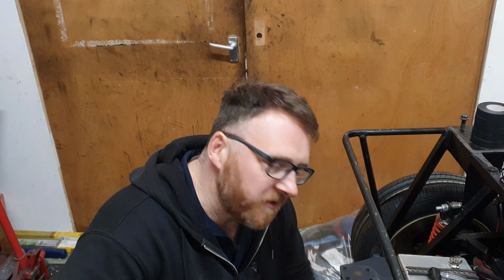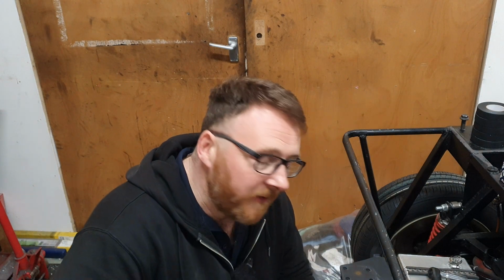If I'm going to get fuel surge issues, and yes, I know guys have pointed out that putting some form of baffle in the tank would help. I don't want to butcher this tank any more than I've already done. If we find that's going to be a problem in cornering, I will put a surge tank in. We have the space, we have the technology.